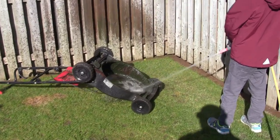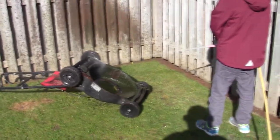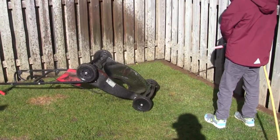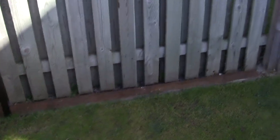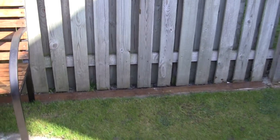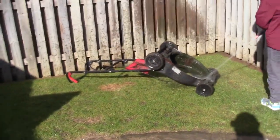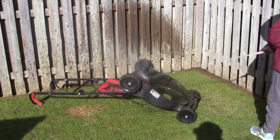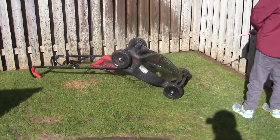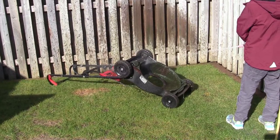We're just softening this up a bit with the hose pipe before connecting the Karcher up. If you've got a lawnmower like this and you don't want to tip it right over, just tip it on its side against the fence with the carburetor side upwards. Lean it half on the fence, pull the spark plug lead off, and then you can get underneath from the side. The last thing you ever want to do is turn your lawnmower over with the engine still connected.